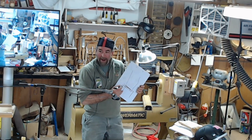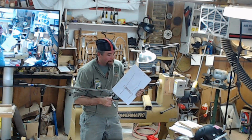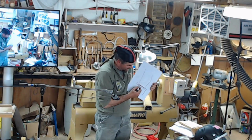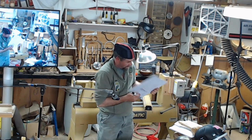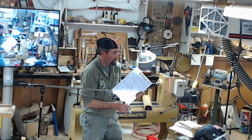It's just, we don't recommend it for homeowners because you're doing a plunge cut. But you can't do your wedges like that either. No. But you can. After you come back and start working your way back, you can put your wedges on the side. Yeah, you can put your wedges like on this area. And then just have that final cut to make where you're cutting the hinge wood.